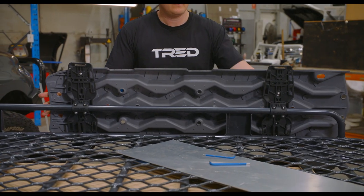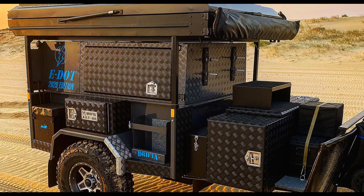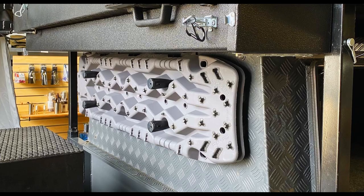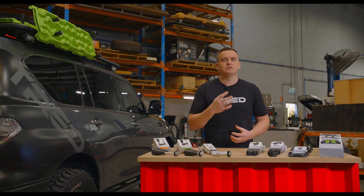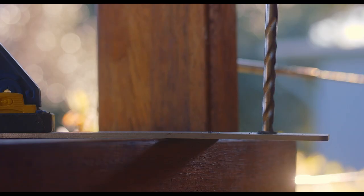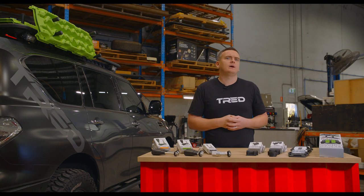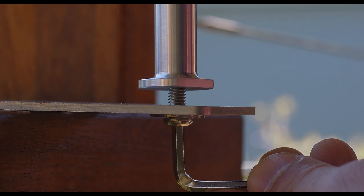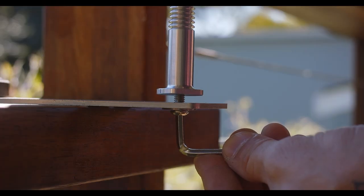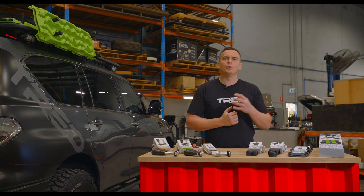You can also just use these pins straight onto a flat surface — for example a toolbox, the back of your vehicle, tray bed rack side panels. To do this, position the pin according to the mounting hole location of the recovery board, drill a hole to allow the M6 bolt to pass through into the pin. After you drill, always apply a little bit of rust proofing onto that hole, then mount the pin on one side and the bolt coming through from the other side. If you're doing this on a sealed box or anywhere you do not want water to pass through, seal that area up with some waterproofing glue.